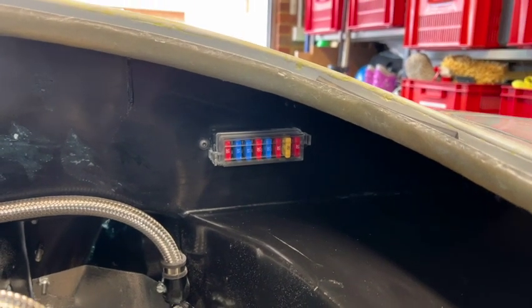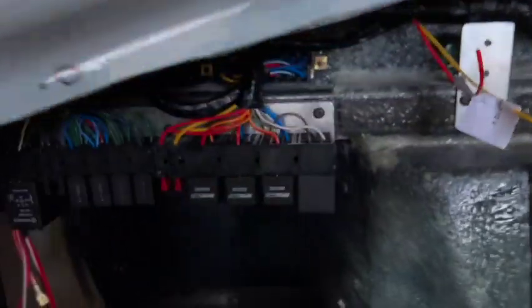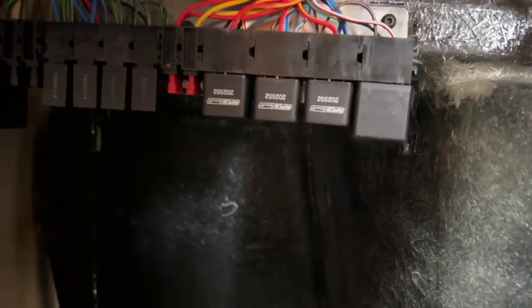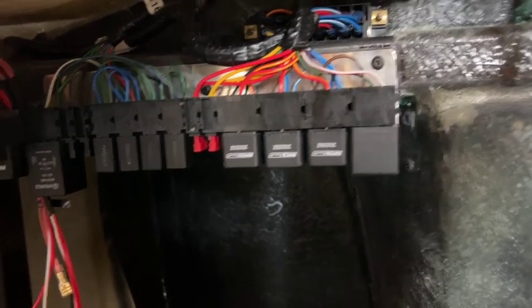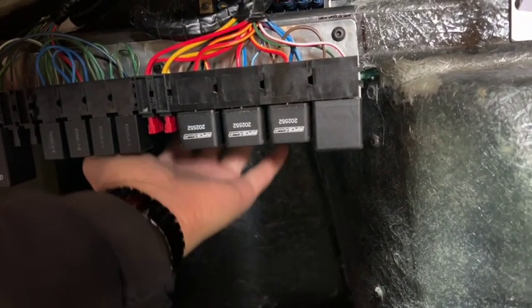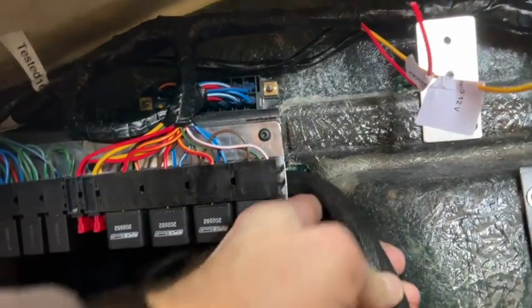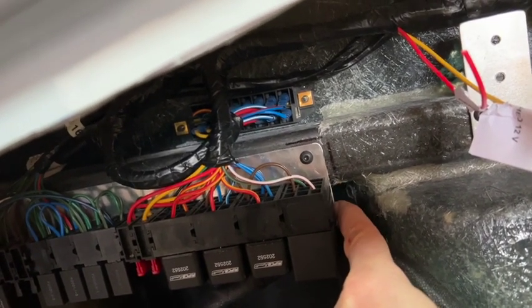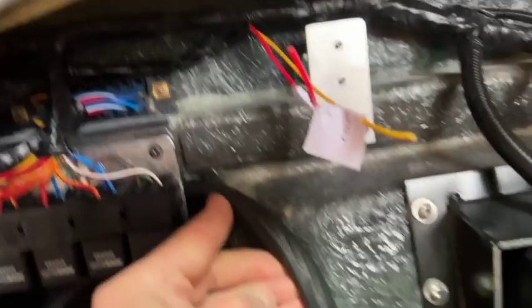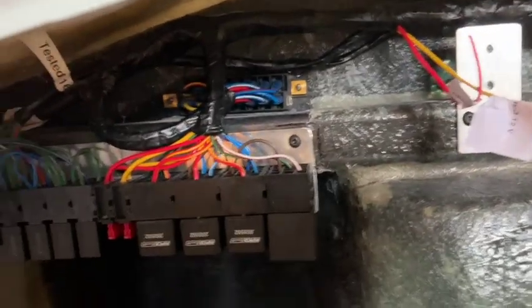A little bit of progress: the fuse box is now in the engine compartment — really accessible, dead easy to pop the cover off and get to the fuses. Nothing zip-tied yet, but it's all looking neat and tidy. I've left a gap here because the ECU needs to be mounted just up here underneath the roof of the passenger bay compartment. I need to leave room for a cable to come out, so I'll put some rubber U-protection on the side so nothing can wear, and that cable will go into the engine bay through a grommet.